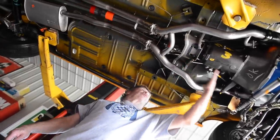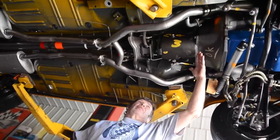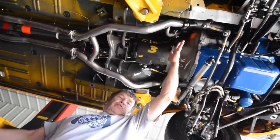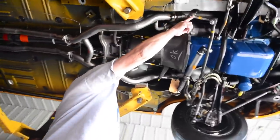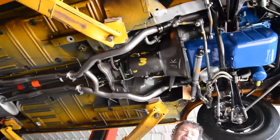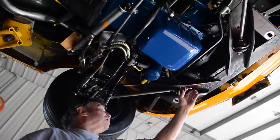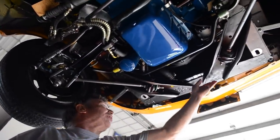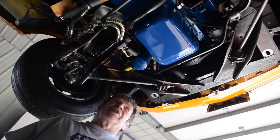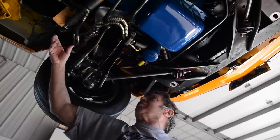The cars started out as a unibody and were not dipped. After the cars were welded together and started to go down the paint line, the undercarriage was painted. From the firewall forward, there was a variation in what colors could be there. When they painted the engine bay after the car was painted, the black paint would blow down into that area to a certain degree, but there were no tape lines — it was just overspray from painting the engine bay. On the bottom of the frame rails, typically there was very little primer, if any. It was mainly overspray from painting the inner fender walls. Up inside where the strut rods go and the front frame rail, usually not a lot of paint — mainly oversprays. A lot of times you'll see rusty bare metal and spot welds showing through.